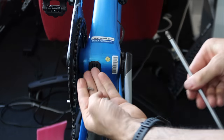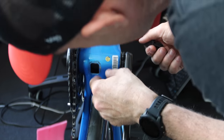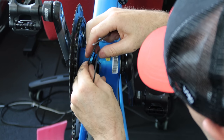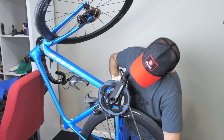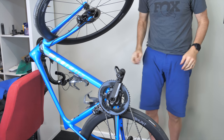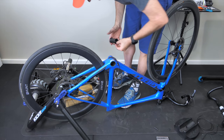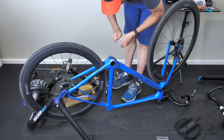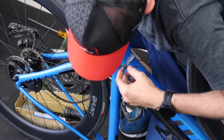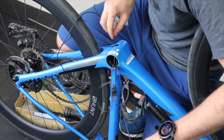Removing the cover — but because I'm running the DUB bottom bracket I can't access the four port junction box. It will not come out of there. I tried pulling, twisting and turning and worked at it for a little while but could not get the junction box out. So after giving up on that, it's out with the bottom bracket and out with the junction port. If you're running the standard Shimano crankset, not a problem at all — the DUB bottom bracket is a little wider which doesn't give you access through that small hole. Down here: four cables — one from the front of the bike, one to the battery, one to the front derailleur, one to the rear derailleur. Looks worse than it is.